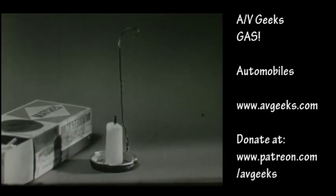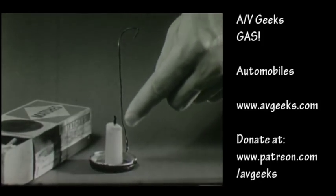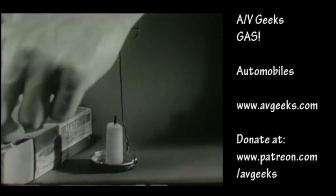The burnt gases must be pushed out of the cylinder, because if they were not, they would keep the next batch of gasoline and air from burning properly. If you want to see that this would happen, just do this. Fit a wire handle on a jar top and put a candle in the top. Light the candle